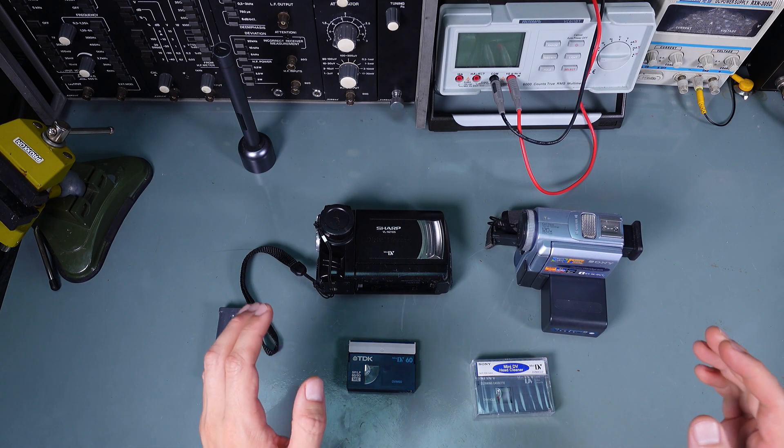As you can see, we've got a great success. Both cameras are operational. I'm maybe going to do one more cleaning cycle — there was almost 30 seconds on one and 10 seconds on the other, and both were completely dead. With this cleaning tape we've got a nice picture with sound. So here is your answer: yes, it does work and you can fix your camera. You do not need to throw it away or go to a service center. Thank you very much for watching, I hope you found it interesting. See you next time, bye bye.